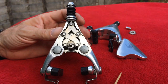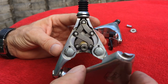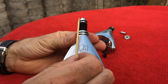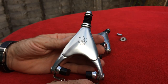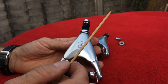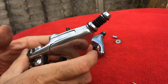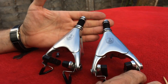A positive thing about them is they're pretty clean inside because they are closed, so they don't hold dirt and dust - they stay clean for a long time. But if you don't care for them and they get filthy inside, you basically have to open the whole system and clean them fully, which takes a lot of time and effort. Quite often you can find these brakes with missing rubber rings, but you can replace them - you can find replacements on eBay. The last generation five pivot brake came with black rubber rings, and you can find them with white ones as well, but over time both can perish since they are moving parts.